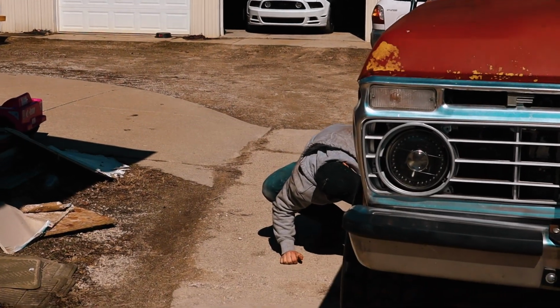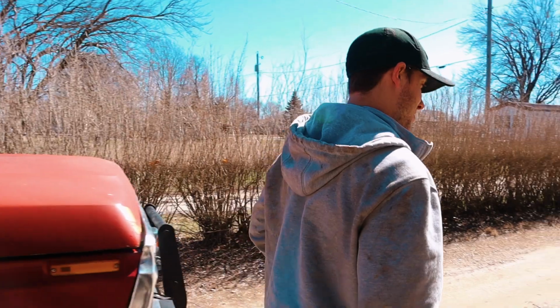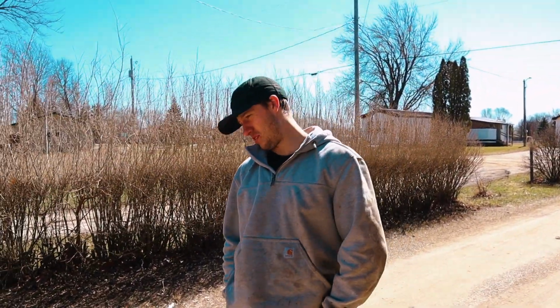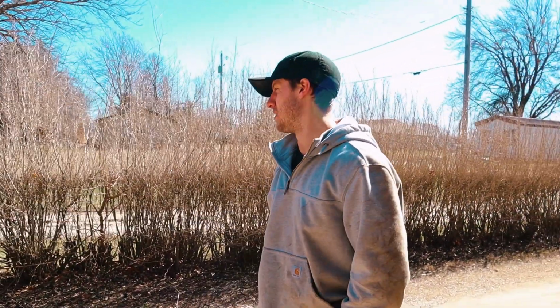She's looking good. So, you know how it kind of bucks when it starts getting up and moving? You remember that at all? So, I think that's because the pinion angle from the transmission to the transfer case is a little steep for the 6 inches that the drive shaft is. So, I think that's why that's so poopy. We're never gonna be able to turn this thing up for horsepower. We're probably gonna have to stay cute and small at the stock horsepower, but.